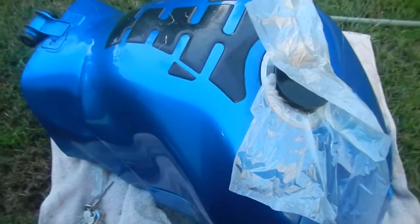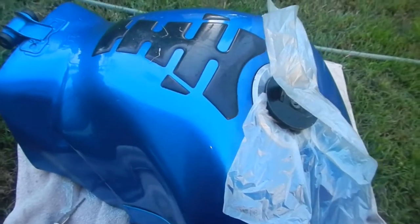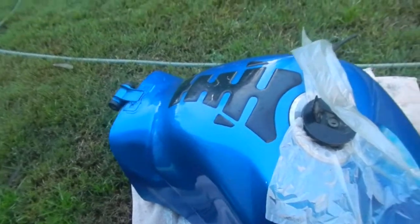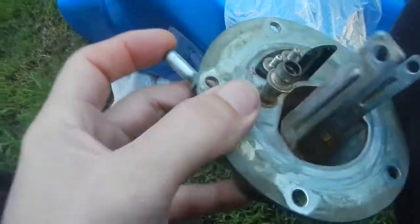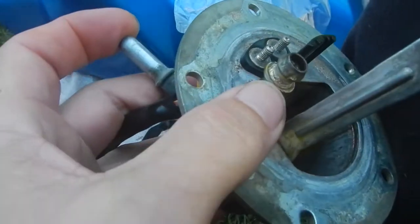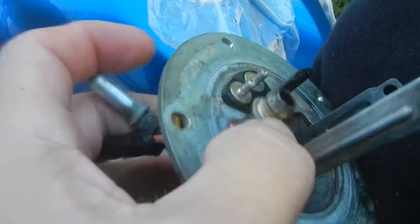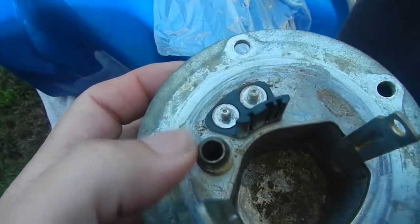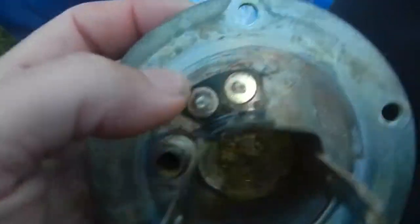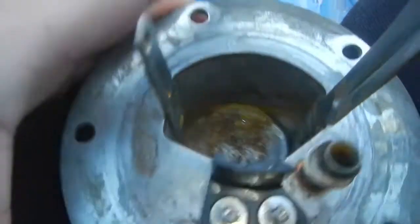On the underneath, because I'm going to refit the fuel pump housing. I am going to be happy to have some of the coating here. This pipe - I have removed the rubber seal that was there. It's quite a large one; that's the one that actually seals going up into the fuel pump itself. So I've taken that off - don't want that coated. I don't want the coating to get down inside here.